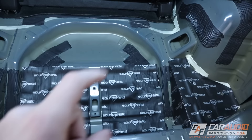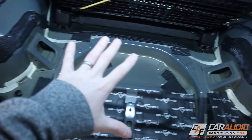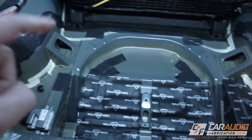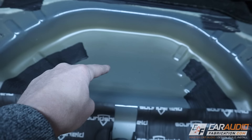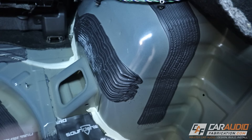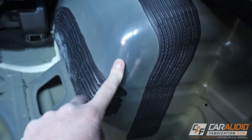Now I've added a couple of pieces and it reminded me of something I want to mention. I see a lot of times where guys will completely cover every last square inch of sheet metal — I've done it myself, there's nothing wrong with that. But if you are on a budget or trying to make use of a limited amount of material, I have some suggestions. First, focus on flat areas first. This is a relatively flat area, this is relatively flat, this area in the middle is flat. But if you're trying to make do with limited materials, you don't need to address areas like this curve right here. The reason is just the way strength works in sheet metal — a curved area is not going to be nearly as likely to vibrate as a flat area. So moral of the story: focus on the flat areas first because those are the low-hanging fruit.